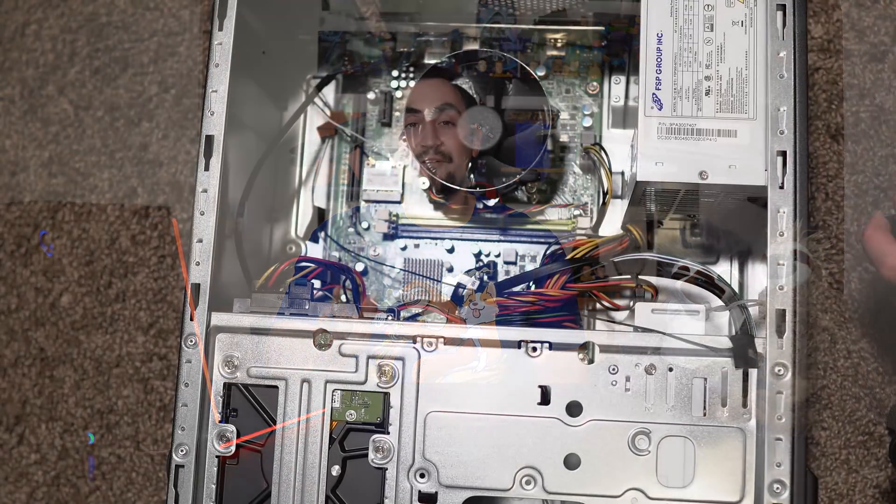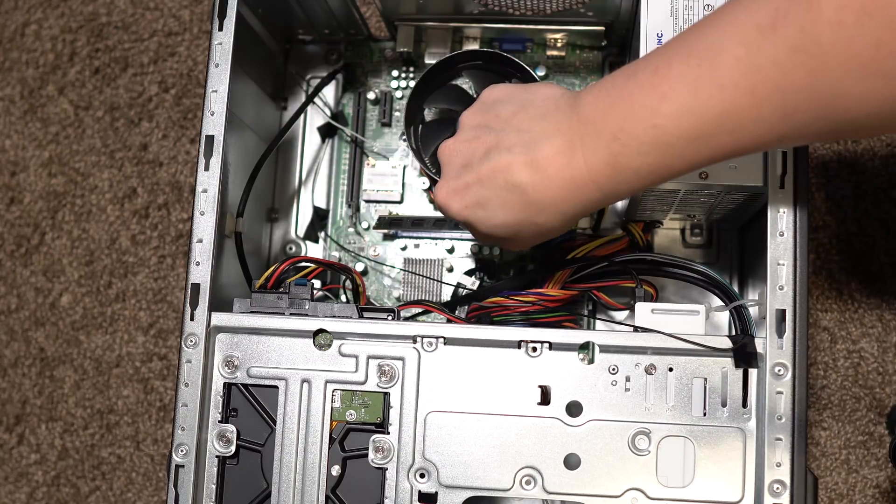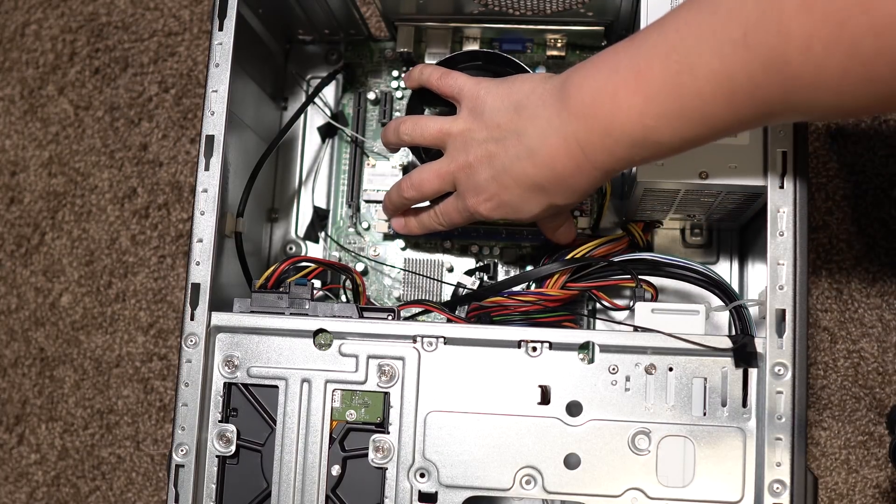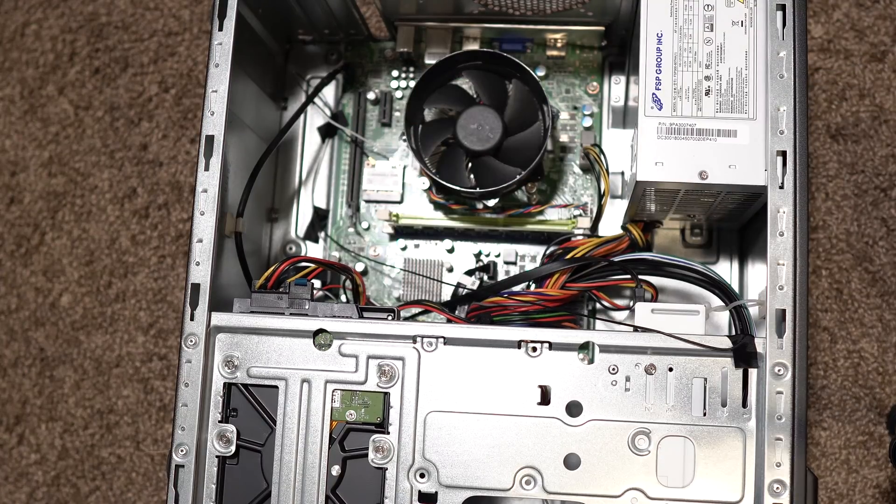It was at this point that I realized the 4GB of RAM was really holding this computer back, as each transcode required about 200 megabytes of memory. The rest of the results I'll be going over today were done with 8GB of memory, but for comparison's sake, I'll cover the before and after so you can see there is a lower threshold for RAM on a Plex server. At around 4GB, that threshold seems to be around 15 transcodes.